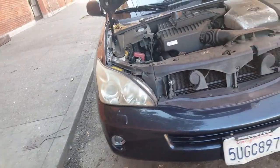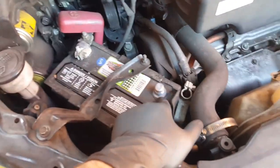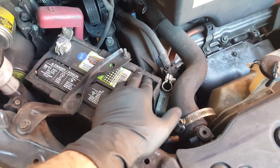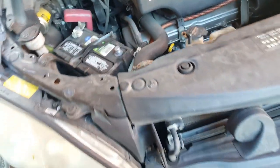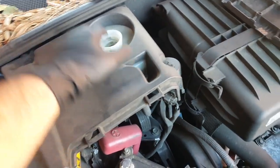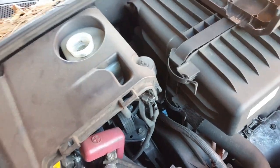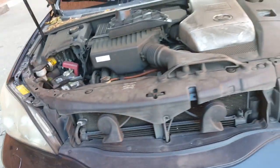So what I did was remove the key as far as possible, plus I removed the negative terminal from the battery just in case, so it doesn't power up while I'm doing brake service. I also opened the cap for the brake fluid reservoir so the pressure doesn't build up — just leave it on top like that, because you don't want anything dropping in there.